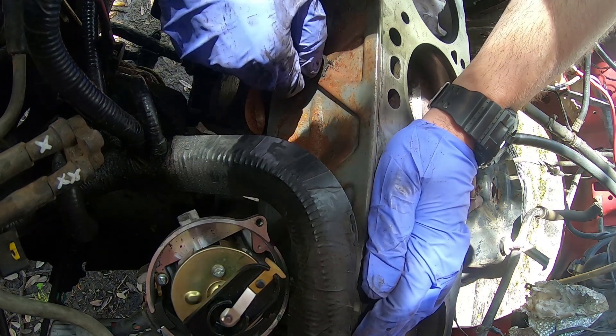Back to this nightmare. That's about good enough. So let's spray it down, brake clean, primer, and paint it. Alright, let's go back with the black. While the paint's drying, I'm going to try and get in here and just knock down a little bit of this grease on the outside. Paint drying in the wind. I'm going to come in here on the water pump and try to get some of this old gasket material off. Once that is dry enough, I'm going to reinstall the tappet gallery cover. And I may try to put this water pump on today.